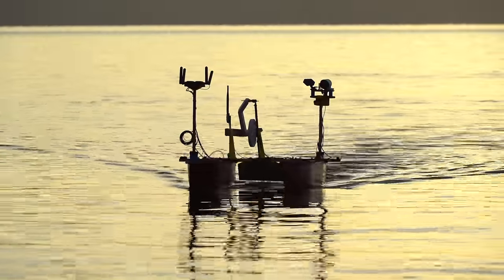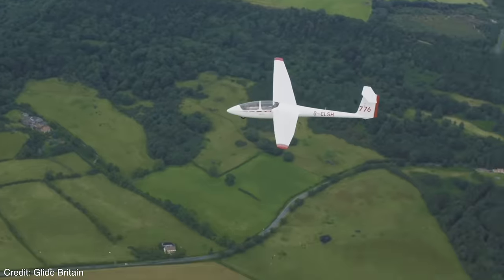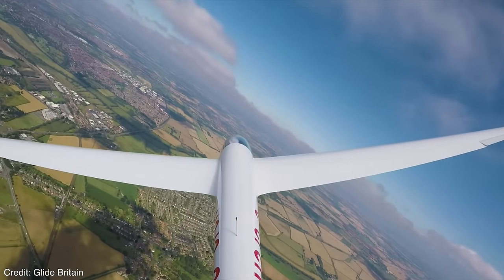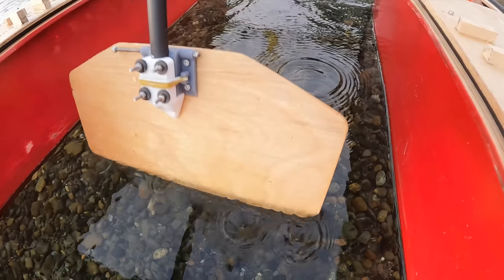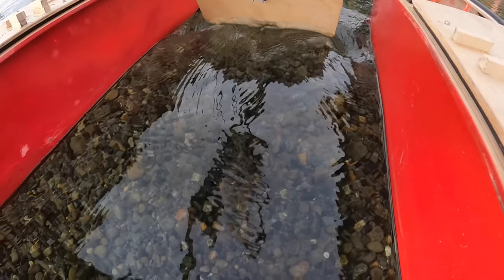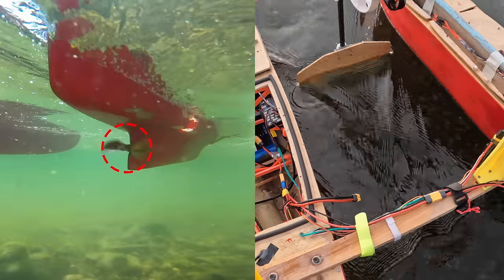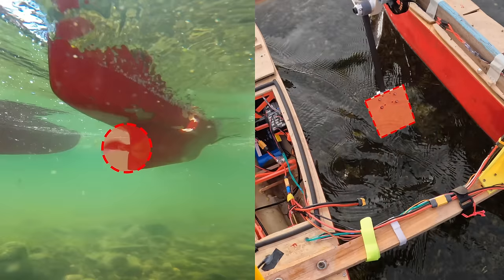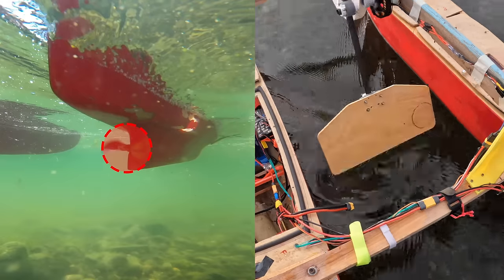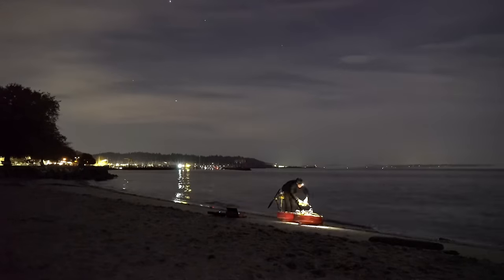It turns out everything was better than the water propellers — the biggest surprise being that the paddle even beat them. I think it really comes down to surface area. When it comes to aircraft design, there's really no replacement for wingspan. That's why I made the paddle as wide as possible — there's less opportunity for the water getting pushed to just flow around the edges and create tip vortices. The dual air propellers are clearly superior, so let's put them to use and retry the big waypoint mission that this boat had previously failed.